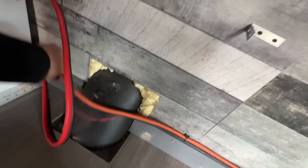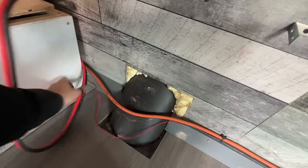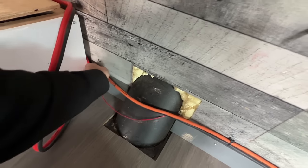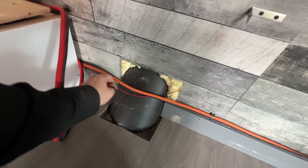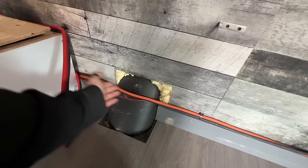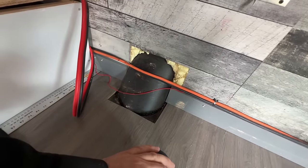We will need some more on this side, sort of to get them out, up, and so many wires. But that's essentially how that's gonna go. Probably gonna loom this part. The insulation from the wire will protect everything, no problem, and it obviously has. The spray paint from this thing has rubbed off onto the power wire a bit, but I have the loom here, I may as well.